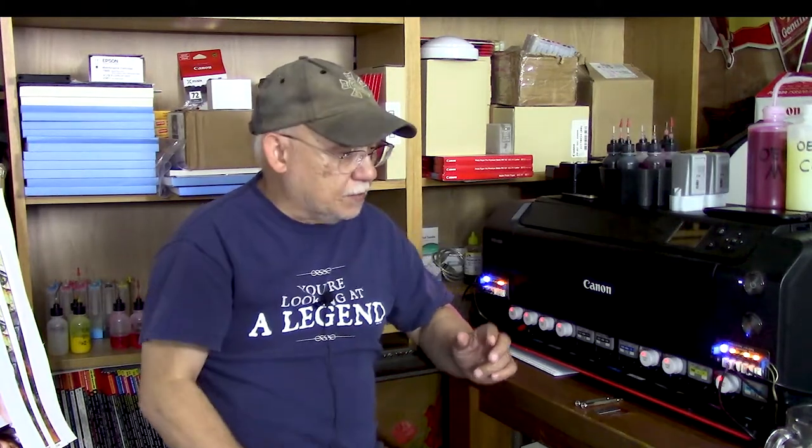With the sensor system, I'll load a little bit less ink than I actually need. I'll have 20 ml left when the light goes on, and I can safely add 60 ml — because you can actually put about 85 to almost 90 ml in that tank. You don't want to do that because you want to maintain a bit of an air gap inside the cartridge. But regardless, the second method is going to be very simple.